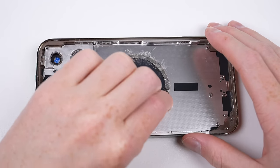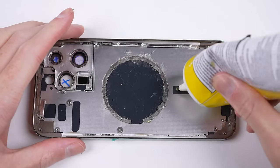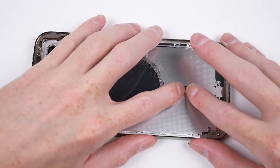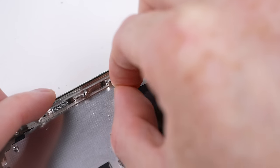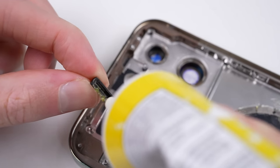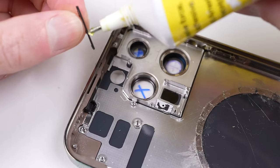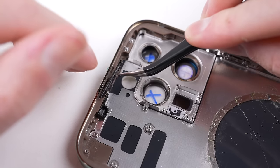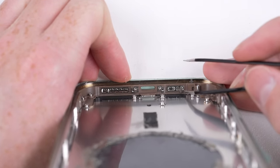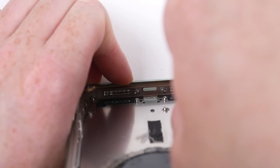It's time for this iPhone's MagSafe magnets to be glued in place. Given their magnetic properties, they tend to move about, so you have to keep an eye on them until the glue sets. Some of the smaller things also need a little glue, like the speaker deflectors and earpiece grill. As long as no glue gets in the perforations, sound will still travel through just fine. As a surgeon and a good phone repairer have in common — steady hands and mad tweezer skills — that's what's needed to put these speaker grills in place.